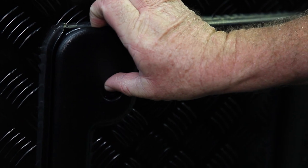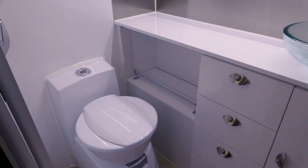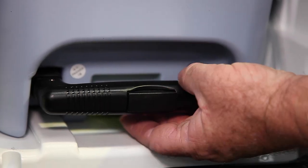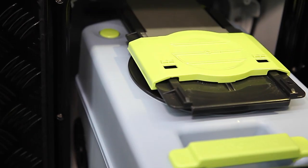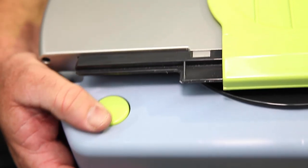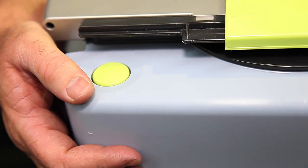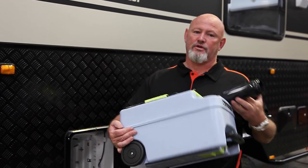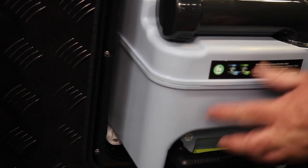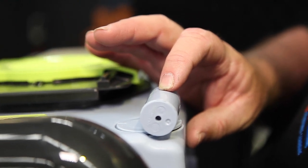The rear right-hand side — which is your driver's side — first compartment down here is your Dometic toilet. Push your buttons in, open her up. On your toilet cartridge, it's actually linked to your water tank underneath the van — this one draws its water from your own tanks. To take it out, there's a little green lever under here. Flick that up, unlocks it, and you drag it out. It's got wheels on. Push the button, extend the handle, and go for a walk to empty your container. When you push this button in, it just relieves the pressure, so when you tip it upside down you can empty all your waste water. Once you get to your dump point, undo that and tip it upside down to empty the cartridge. Put that back on, put it back, lock it off. There's a little sensor up top — you've got to make sure that connects to make sure all functions inside work properly. Also, on your toilet cartridge, it's considered to be black water, so you must dump it in the appropriate places.